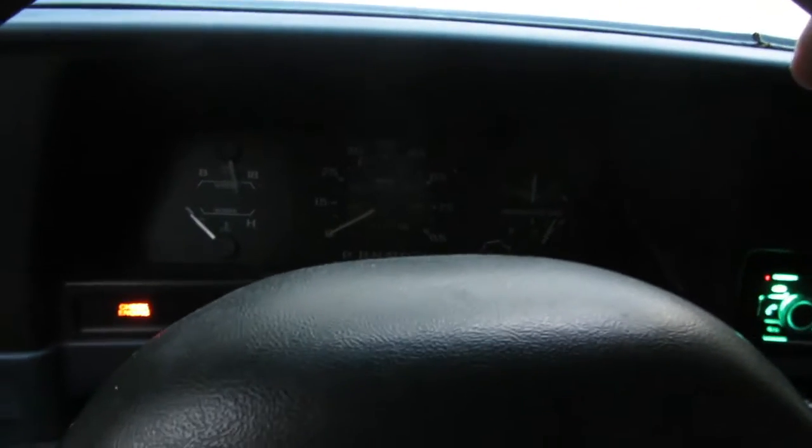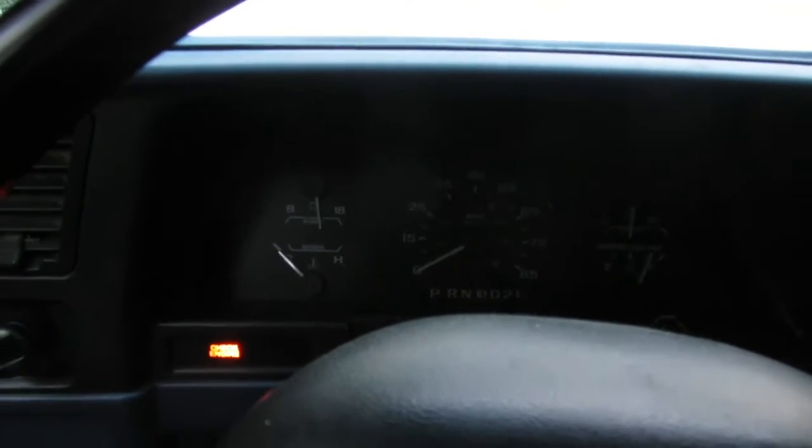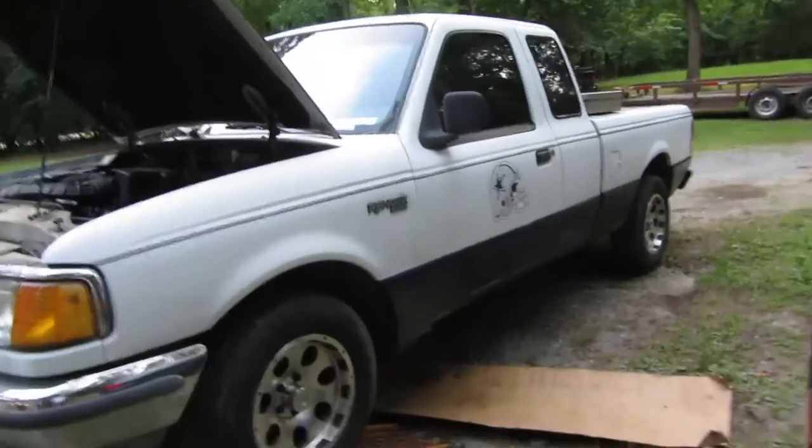There's a check engine light. I don't know if you can feel how this thing's vibrating like crazy. All right, I think I know. You're going to come under here with me. It looks like there's a hole in one of the fuel lines. It's hard to mark it. Yeah, it's not too hard to see where it's leaking fuel. Yep, that's exactly the spot I thought it was.